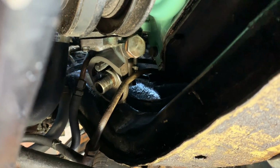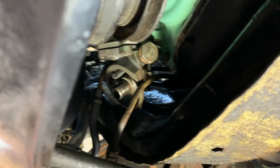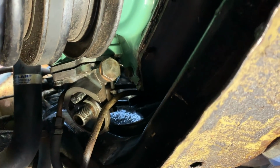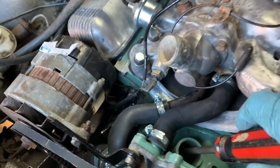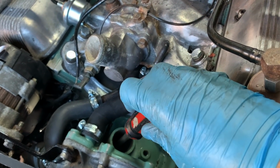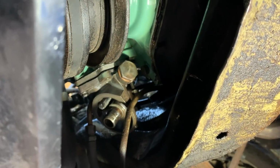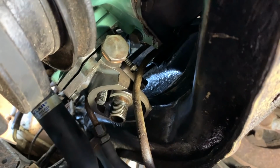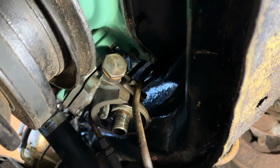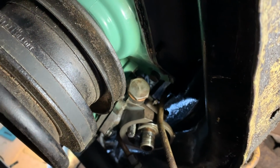Right, I've been underneath the car and I have slackened off the 5 bolts that hold the oil pump onto the bottom of the engine, and I can now get a big screwdriver, find a peg in the top of the oil pump, and it rotates smoothly, which means the cover of the oil pump is clamping down too hard. So I guess the gasket between the body and the shim and the pump isn't thick enough, giving enough clearance. It's going to be a fraction of a millimetre it needs.